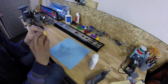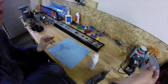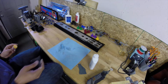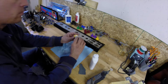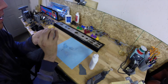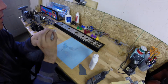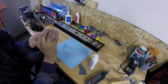Yeah, I'm actually getting stuff off with my fingernail. So let's see what I got here. That's a 2000 grit paper. That's a polishing paper. 400. And I've got that bucket of water here, so I'm just going to use plain water on this waterproof paper. I'm just lightly going over this thing. I don't want to sand it down or change the shape, or change the shape as little as I possibly can, just to try and get whatever this gunk is on here.